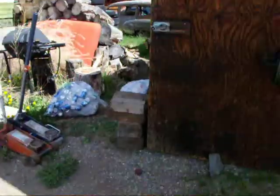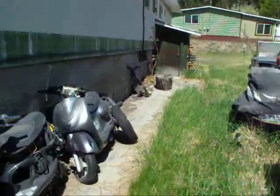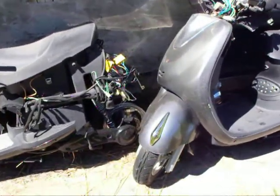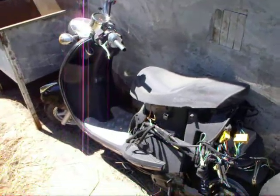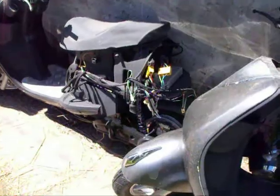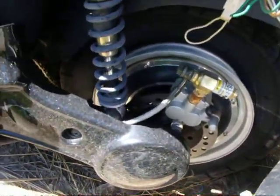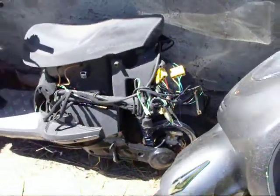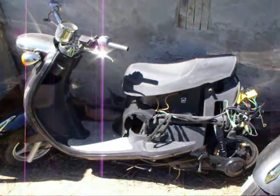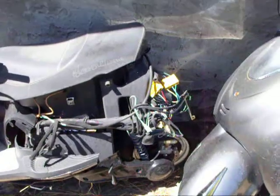With a budget of $1,000 you've got to start with used parts. I'll show you what we started with — take it to the backyard full of junk. I picked up a whole lot of these old rental scooters for tourists around town. What went wrong with most of them is they all had alarm systems, and that always goes wrong if you know anything about old 90s stereo stuff — as soon as the alarm goes bad, the whole car doesn't function. So there's the controllers. They've got a hub motor inside the wheel and hydraulic disc brakes. The rest of it's garbage, but that hub motor and that controller — that's the gold in these. You can find these cheap. For $300 or less you can usually pick up one of these with no batteries, no charger, just a junk scooter. More likely than not the motor's good and the controller's good.